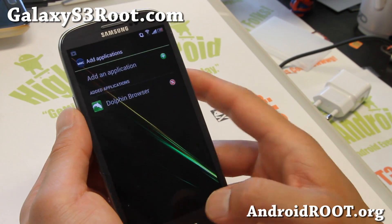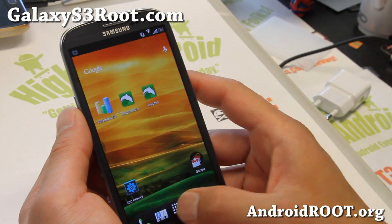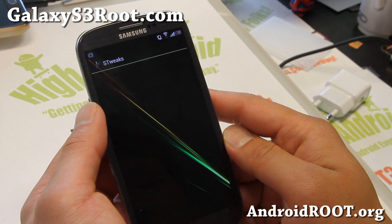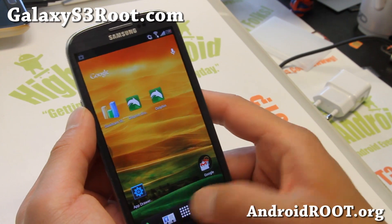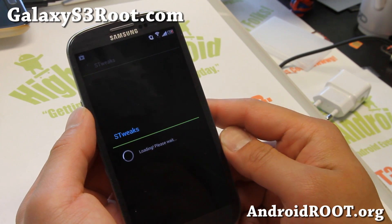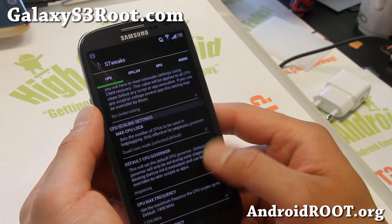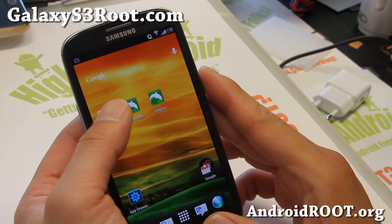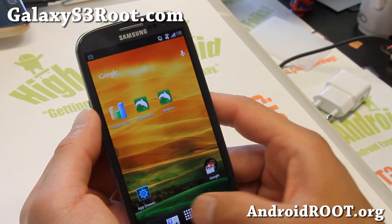I added Dolphin there — that's how you do it. Battery life should be pretty good on this ROM. You also have the option of running different kernels. The one I'm running is draining a little quicker than I'd like — S-Tweaks sometimes does that. You can overclock it to 1.8 GHz, though I haven't successfully run Quadrant at that. I recommend 1.6 or 1.704 GHz at most. I did get near 6,000 on Quadrant — about 5,700 — so performance is pretty good.